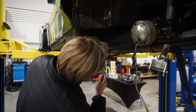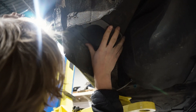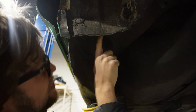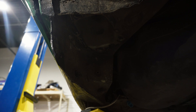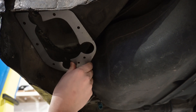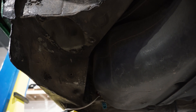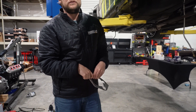We have this piece here which is supposed to weld in here to give the body more rigidity — it doesn't really fit that great. That's why Wise Fab wants you to cut out like this whole inner area, or at least a piece of it. It's to fit the bigger toe adjustment thing, and the anti-squat adjustment piece is a little bit taller. I might weld these in, I might not — I'm not really sure yet. We definitely have to cut this stuff out anyway. That's one of the negatives of the kit — you do have to cut the body. But if you're installing these arms, you're probably already pretty used to cutting up your car.